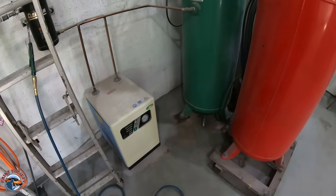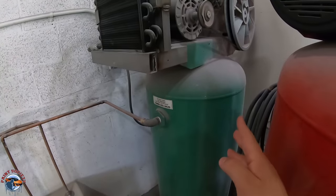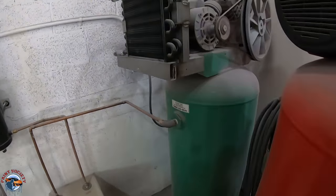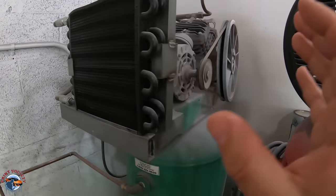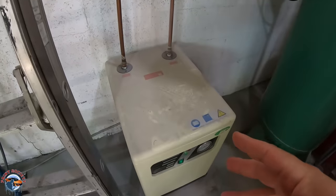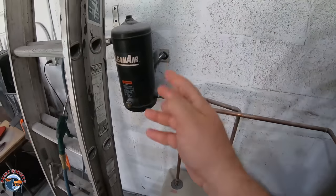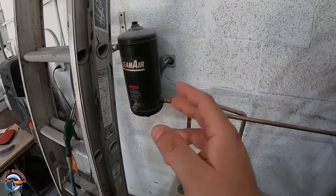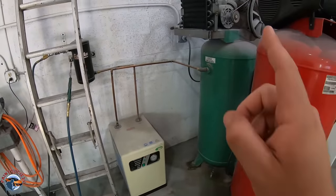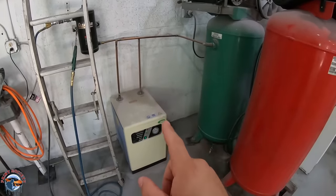If you're serious about painting you need a compressor that will give you enough air to get around the whole car. They've got a 60-gallon compressor, and as it compresses air it produces hot, humid air. The guys made a makeshift cooler to keep the compressor and the air cool, and they also have an air dryer — and a little bit of overkill — another air dryer water separator. From there they're ready to paint. No need to run piping 30 or 40 feet when you have a setup like that.